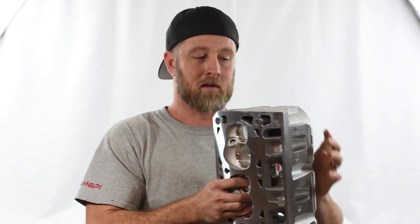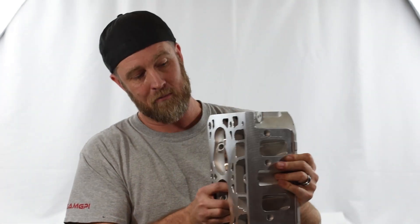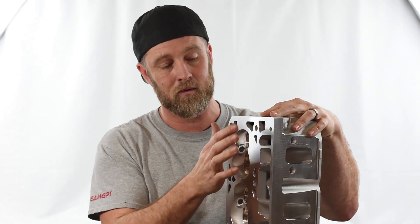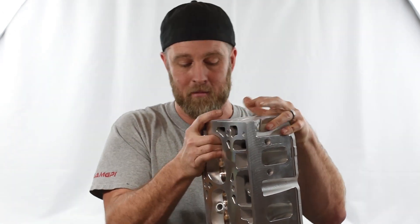You really need to consider the chamber width — not only just your engine bore — because different heads are going to have different chambers. You widen this up, you go and unshroud these valves, and that helps flow, but you need to make sure your head gasket is not hanging over past this chamber diameter.